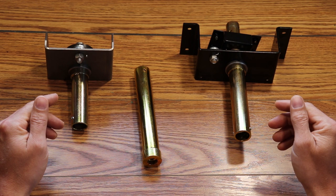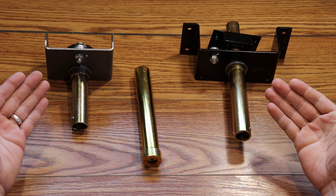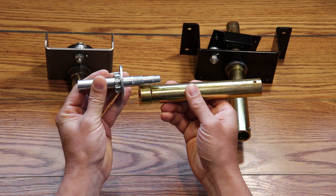Raise the roof. With the roof fully extended, crank the handle to the right one half or one whole turn. If this is all the pop-up needs, you will typically hear a whine or a squeak from the tube as the compression resets. What you've done is you've moved the drive shaft forward into the tube, and the clutch can once again fully engage in the assembly.